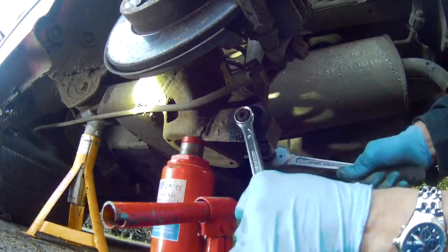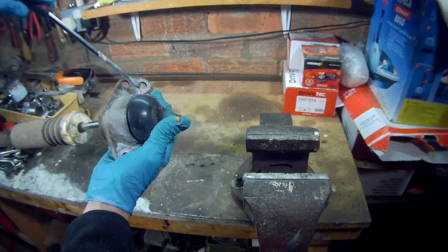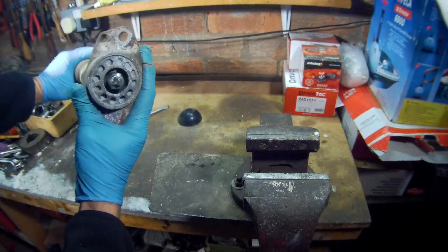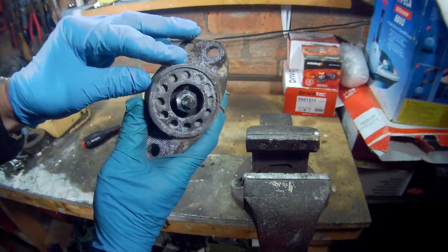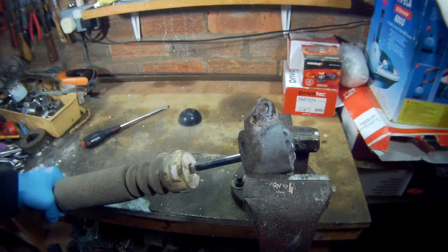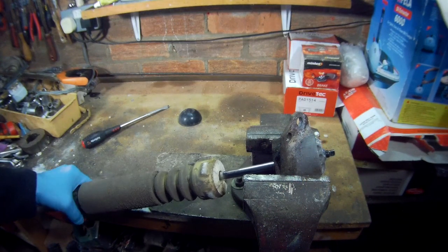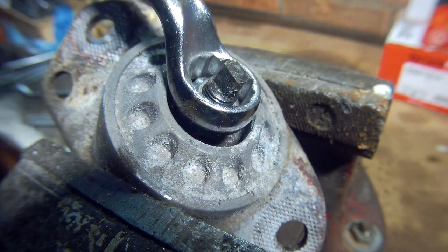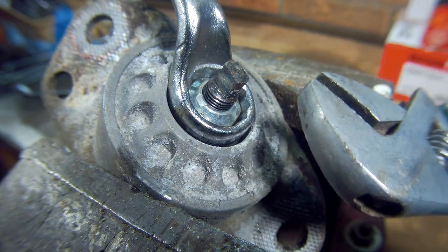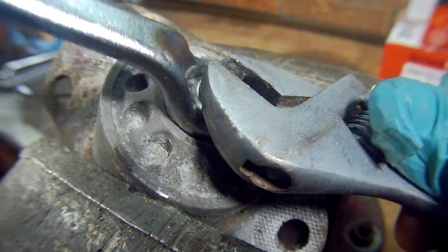Now take the strut away from the car, and you have to take the strut mount off at the top to use on the new strut. Prise off the plastic top cap with a flat-bladed screwdriver. If we look at the strut mount end, we can see a nut holding the piston shaft, which has to be removed without the shaft rotating. I find it easier to hold the mount in a vise with the body supported for more control. Be careful not to over-tighten the vise on the mount and damage it — just put some wood between the jaws to protect the mount. As the nut is recessed into the housing, the best thing to use here is a 17mm swan neck ring spanner, then grip the threaded strut with an adjustable spanner as you unfasten the nut.